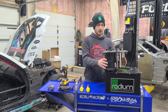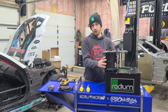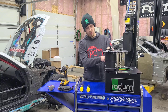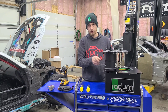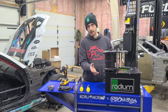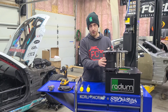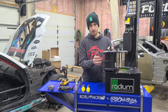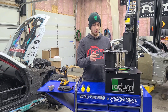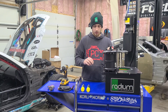How this works: you have a lift pump in the tank that lifts fuel and keeps the surge tank completely full at all times. It just free-flows fuel in, and the fuel will overflow from the surge tank back into the main tank, constantly circulating. That keeps your high-pressure pumps, which sit inside the surge tank, submerged at all times. That not only helps them stay cool but also eliminates any chance of them ever sucking air.